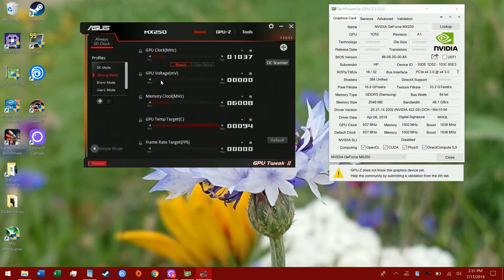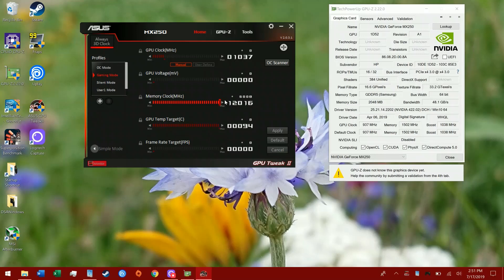If you go back, it really will let you go that high - and this would freeze instantly if I hit Apply now. I got this stable at about here, so I did get that extra 5% bandwidth. It's a 64-bit graphics card, so any clock speed increases you can get will yield more performance almost linearly. You're also going to want to set a frame rate target. For me I settled on 33 FPS - at 33 frames it never drops below 33, it feels a hair smoother than 30. This is a laptop - a very thin one - it will saturate with heat and start throttling permanently if you don't cap it.